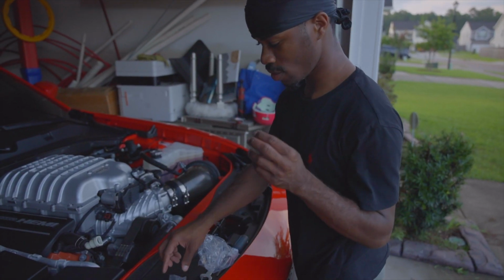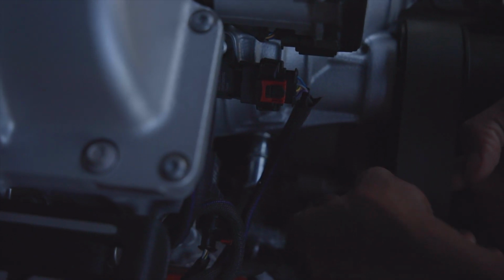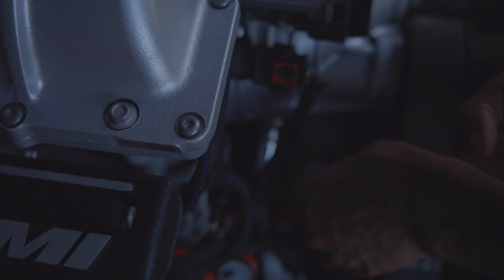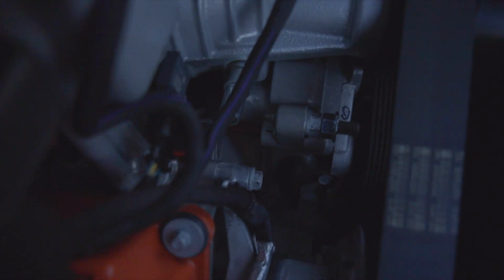So you wanna get one of these nuts out of the bag and put it on this bolt right here, and you gotta screw it on there. Make sure your engine is not hot before you do this, because that'd be bad. Look out. I'm just gonna snug tight that real quick with this 15mm.